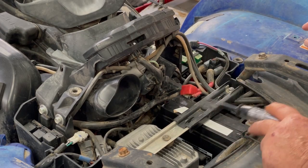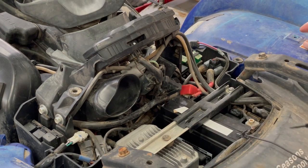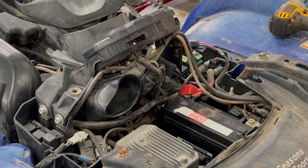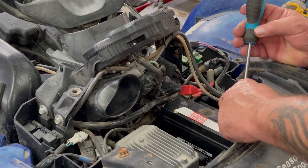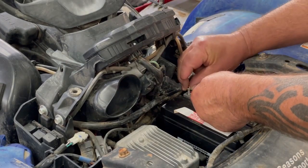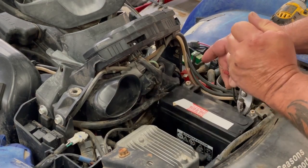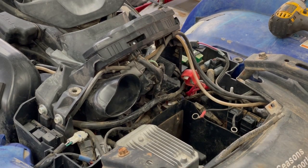The next step — I take this bar off here, take the battery out, and the ECU is sitting right down here. This bar holds the battery and that's 10 millimeter. Take out the battery using either a 10 millimeter wrench or a Phillips screw. I like putting the screws back in there because there's a sliding nut underneath — that way you don't lose it. Go ahead and slide that out. Two 10 millimeter bolts hold that on.